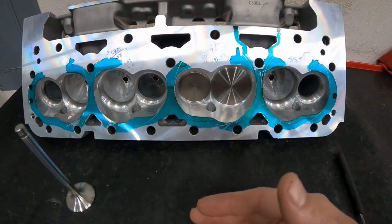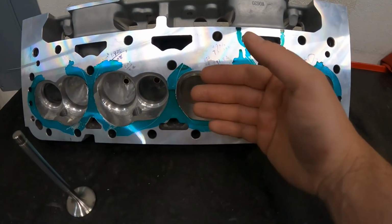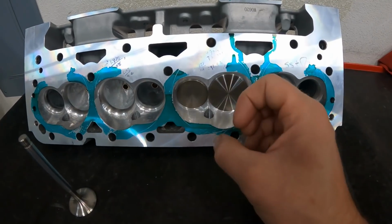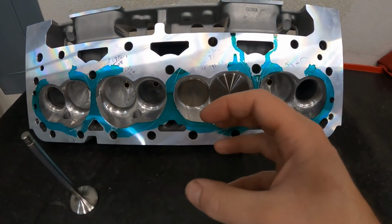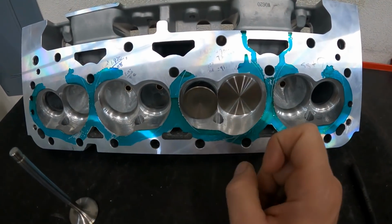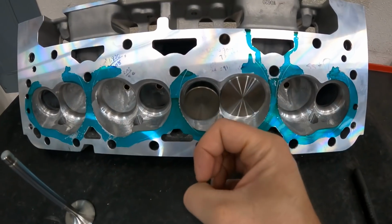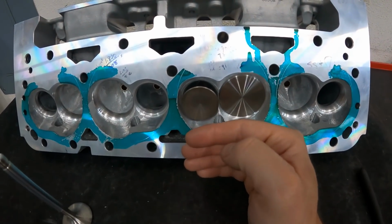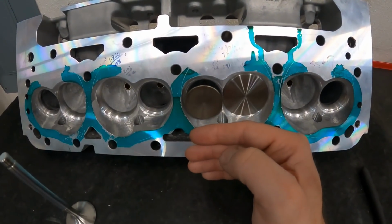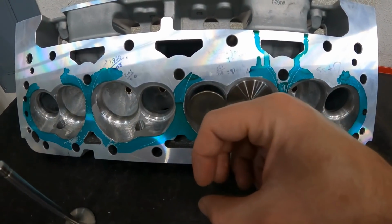So air draws in, of course, gets compressed, and then there's an explosion that happens and the piston starts moving down. Well, when that explosion happens, or when the fuel's ignited, it's creating a high pressure area in the port. And then the exhaust valve opens and that high pressure gas leaves. Well, that high pressure gas leaving creates a low pressure inside the cylinder while the piston's still on its way up, as it's towards the top, I should say. The exhaust leaving at high pressure leaves a low pressure point behind.